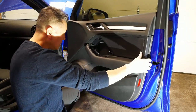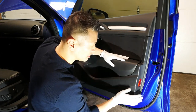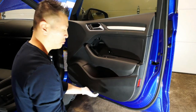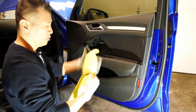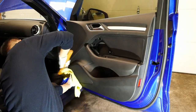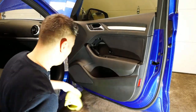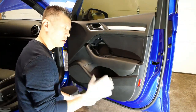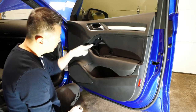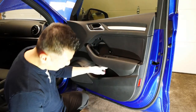At this point we have successfully put the door panel in. I'm going to go ahead and tap on this area to lock it into the clips — you'll hear it pop. The door panel is pretty solid; you can use your fist or take a mallet and slightly tap in these areas. Installation of the door panel is complete. We'll replace these two bolts, then replace the speaker grille and finalize it with the last bolt, and we are done. Here is the final outcome — the door panels in the back.